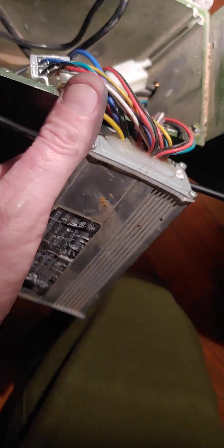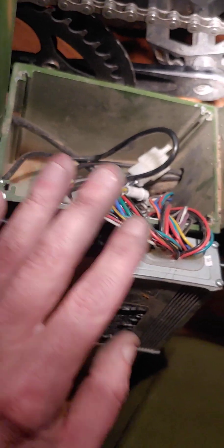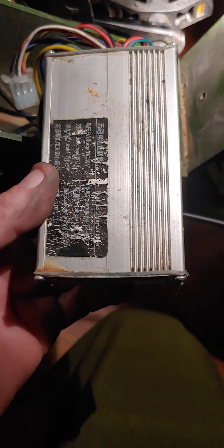If you're swapping out the rear tire on your bike, the first thing you want to do is take off the battery rail, then take off two covers, and then one by one take these apart and disassemble the rear tire. Someone pointed out that the connectors are actually in a different place — on the new bike the wire coming from the rear motor comes down and has a connector outside, while this one has a connector on the inside. So if you're swapping it out, there will be a difference in the length of the wire — something to take into consideration. If you're going to swap out the rear 750 watt, use the original controller that came with the original bike and all your wire placement should be good and everything should go back together. I'm going to put all the electronics from the old bike on the new bike and then give it a test.